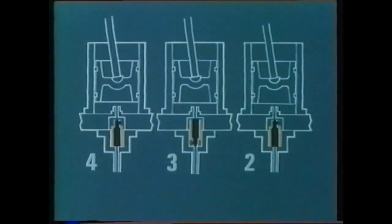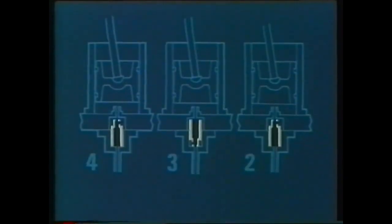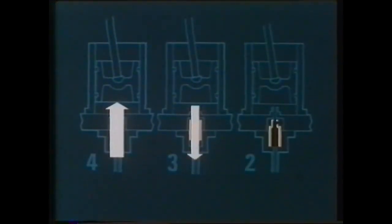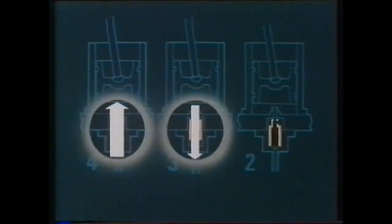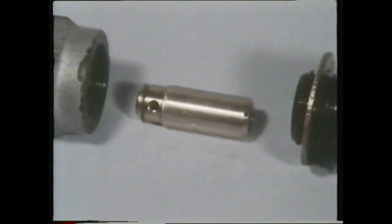Therefore, in a three-gear change situation, what will be the result of a restrictor being fitted the wrong way round in an up-gear change sequence? When second gear is released and third gear is applied, second gear comes off at the correct speed but third gear, because of the wrong airflow through the restrictor, goes on too quickly — and the result is band overlap or a momentary two-gear situation. On the gear change from third to fourth, a similar situation but in reverse will occur. When third gear is released, because it has only one air escape path instead of two, the band will come off too slowly while fourth gear will apply at the correct speed, causing a band overlap situation. So remember, always ensure that restrictors are fitted correctly and that it's the correct restrictor that you fit.